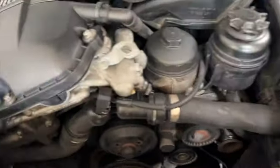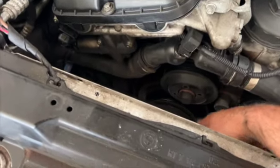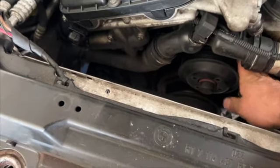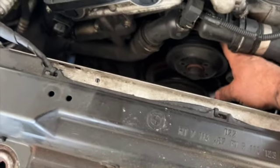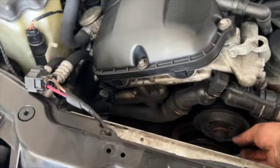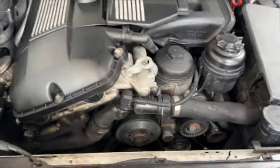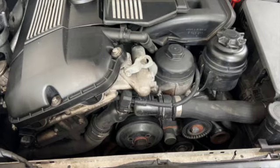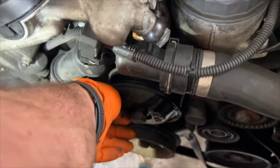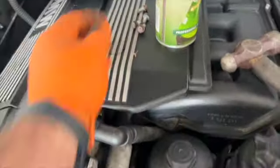The problem you may encounter is the plastic pulley has pretty much fused onto the water pump. The fact that the water pump has got massive amounts of play makes it a little bit harder. What I'm doing is putting one bolt in there loosely and giving it some light taps just to try and break that seal. Hopefully it comes off — I may order a new pulley just in case. The car gods have smiled down upon me today; that did not take a lot of abuse.